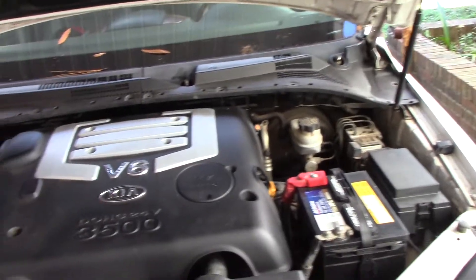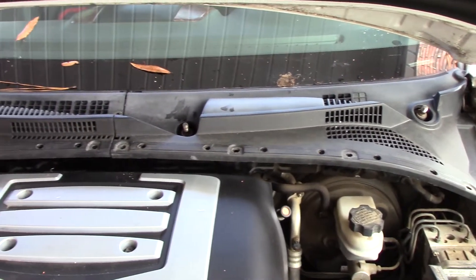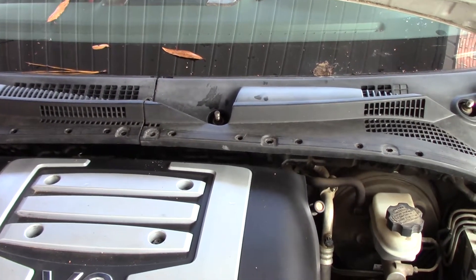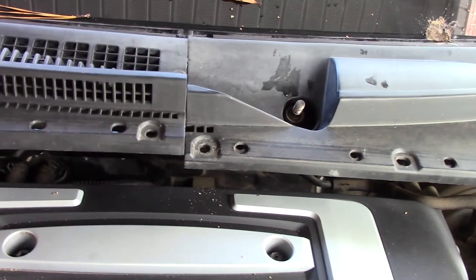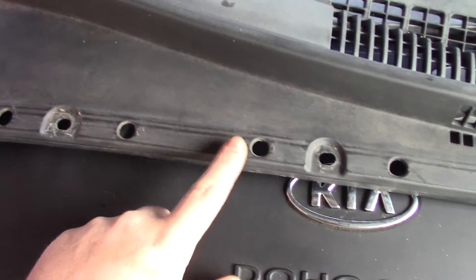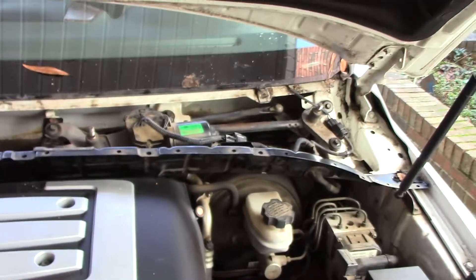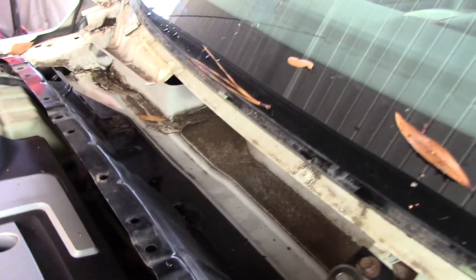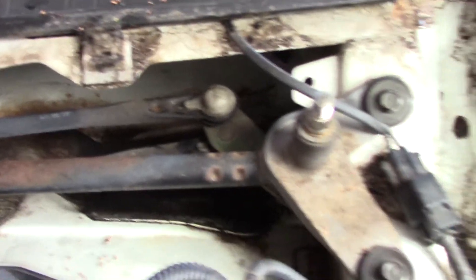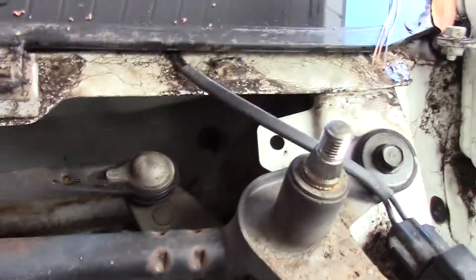Once you pop the hood on your Kia — and many cars are like this — you remove the wiper arms. I've already removed them. You have 14-millimeter nuts that hold the wiper arms, and you can move those back and forth to get them off. Then you have your gutter cover here. You should have little plastic push pins holding it in place — retaining clips. Once you remove both of these, you can access your wiper motor, the arms, and this is your rain gutter. You can see there's still stuff in here — this discoloration, it's like a door jamb, it collects dirt and can get stopped up.